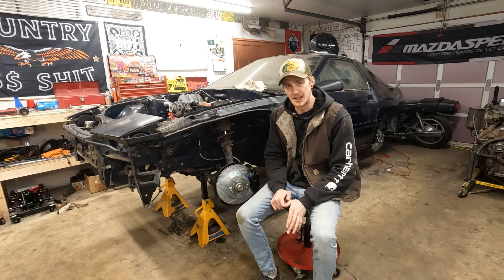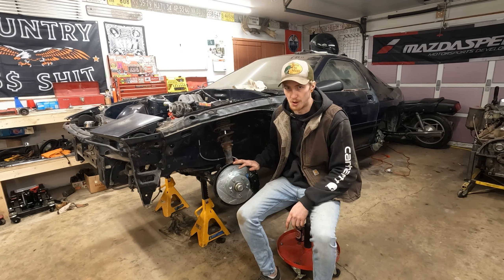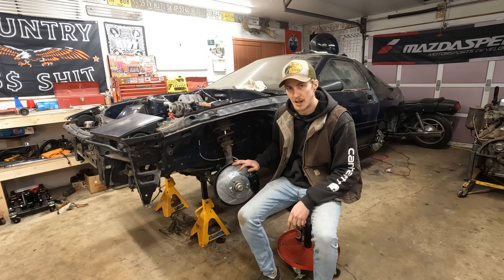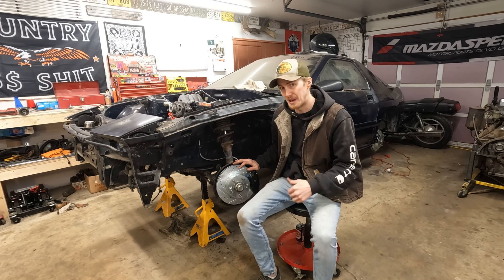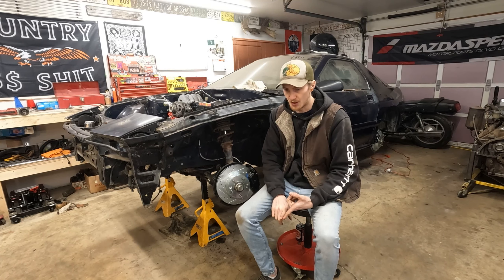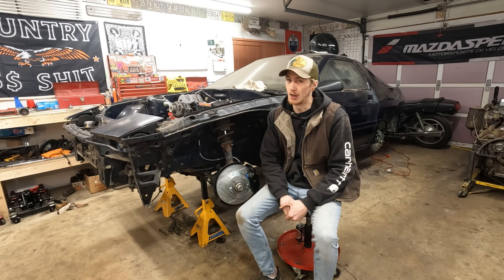I had issues with the brakes — not so much these brakes, but with the original brakes. Both fronts were shot. I needed to find remans for them; there was no way I could rebuild them. I was able to find one reman, bought it, got it here, and was actually able to get a piston cup for the other one and rebuild it — but the rears were cooked. The rears were rusted right out. I couldn't get bleeder screws out — they were breaking. I couldn't get the pistons out, and once I did they were mangled, rusted beyond saving.